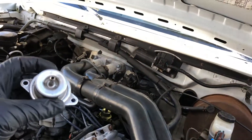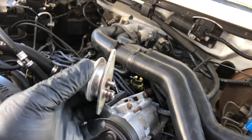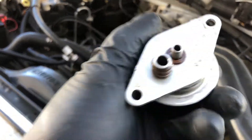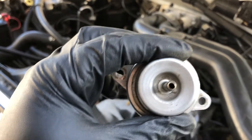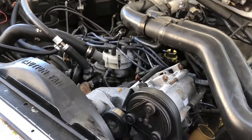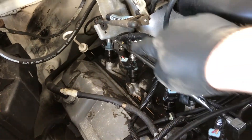For posterity's sake, this is my 1994 Ford F-350 with a 460 V8. The 460 cubic inch V8 has a vacuum-actuated fuel pressure regulator. That little gold thing in there is what I just replaced — it sits on the fuel rail. It regulates fuel for all eight cylinders via these fuel injectors. If that thing is not working, there won't be fuel getting to the engine.